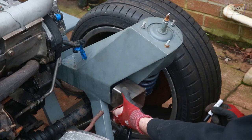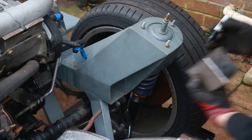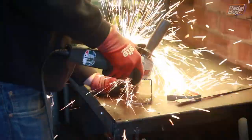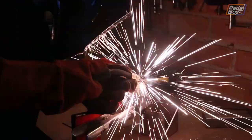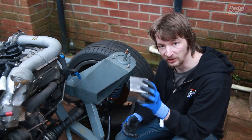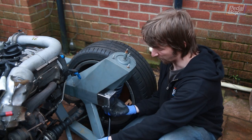To fit seamlessly onto the end of what's there, we have to make a notch and take one side out where it contacts the suspension turret. That will allow the extension to fit flush and seamlessly onto the rest of the car. As we're welding smaller section box onto the end of this, we've capped off the end to give all four sides of the new extension something to weld onto. These are basically the same 80 by 80mm box as before — we've cut a notch out the side so it fits over our suspension turret, and we're going to cap it off, nice and easy.